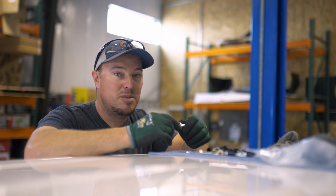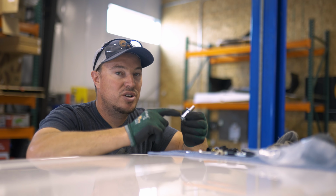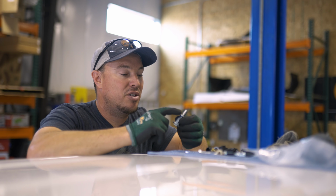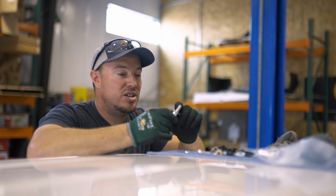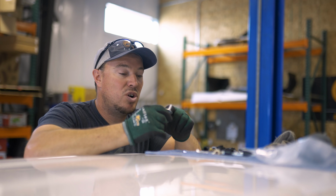Compressing these is gonna be the same process. You'll take your longer bolt, apply a washer, the hex coupler, and another washer, and screw the riv nut or plus nut all the way up to where it's butting up against this washer tightly.